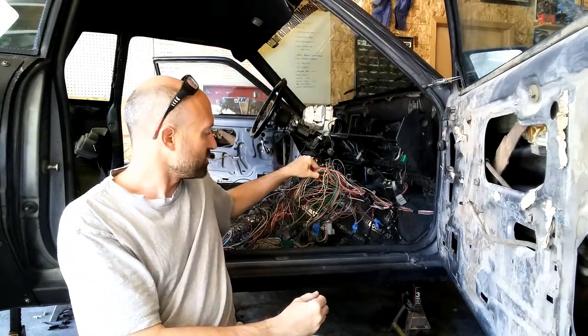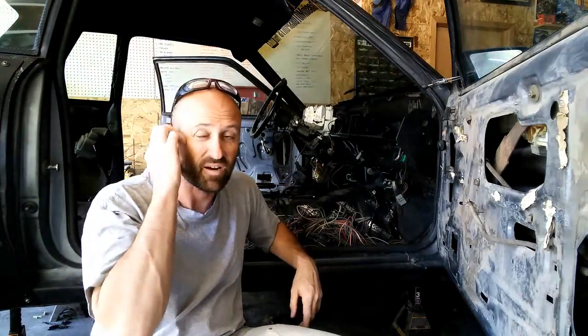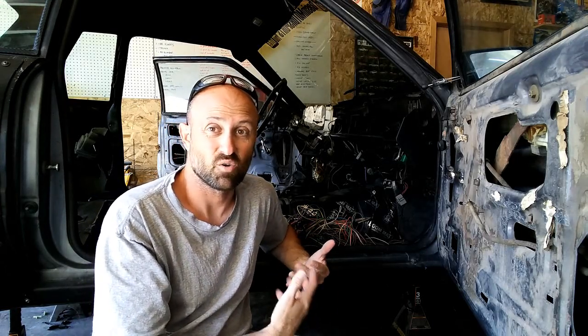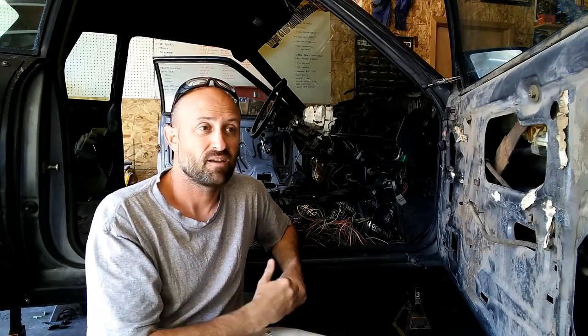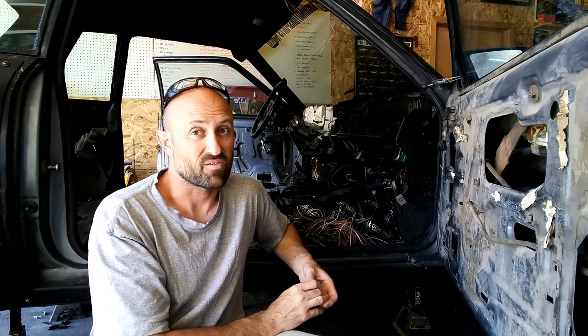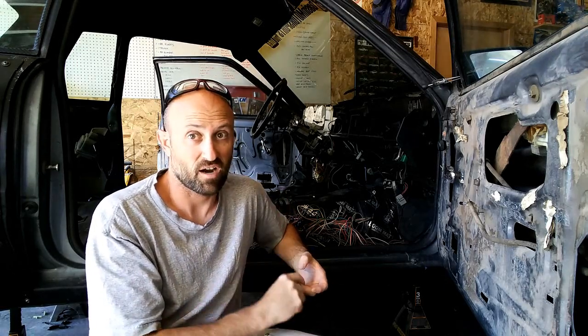So I think the last thing really to do is just get the power to the ECM. That's where I think I really need to focus now. The always on power is there. It's the switched power is what I really need. So that's probably the last piece to work on. Now I'm also going to connect up the car to the battery and make sure everything else works in the car itself. And then it should be, I think, one wire, just the switched turn-on wire for the ECM. And I think the car, once the fuel pump's on, should fire.